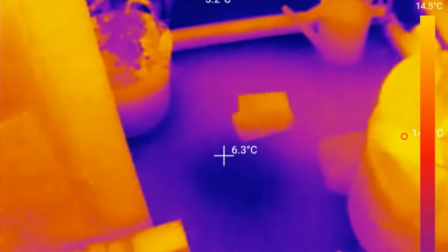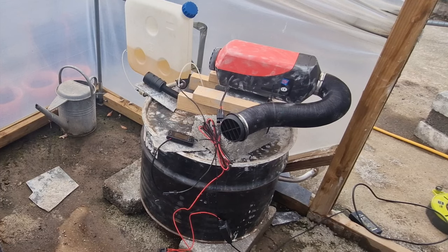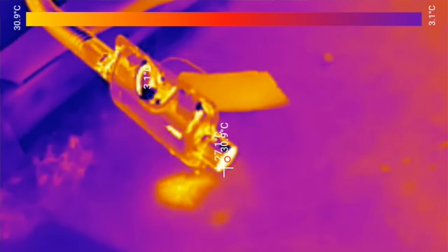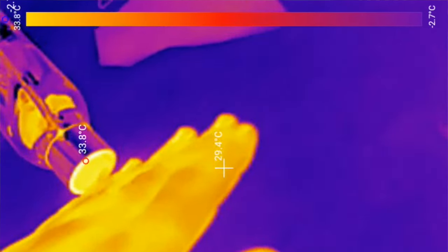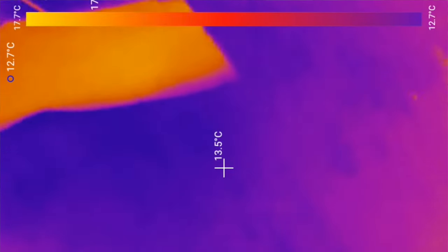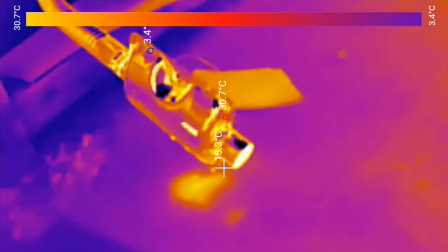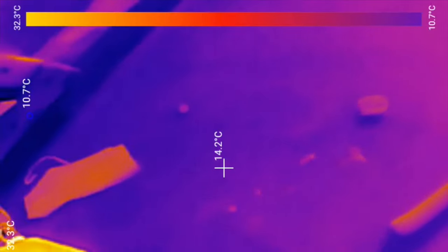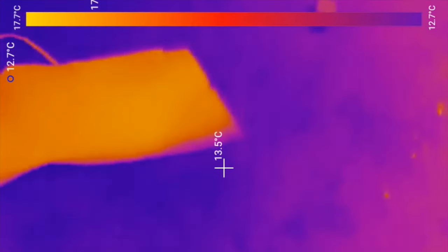So what I'm going to do is fire it up and then we're going to see how the heat changes. So we've been going for a little while — it's heated up, it's all going. Let's check the thermals. It is water, and the water is also finding its way down here, which is really good news. At the rate this is burning and the air coming in, the air in here is about 80% humidity already. The fact that the water is actually condensing and coming out of the muffler is absolutely amazing, because it means the whole exhaust is running downhill the whole way, which means we won't get any error codes or problems with the diesel heater.